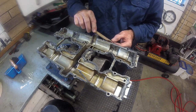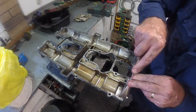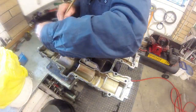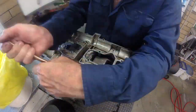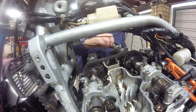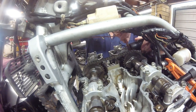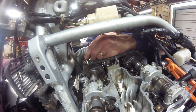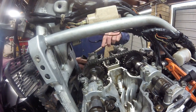The copper won't mark or gouge the aluminium alloy like steel would, so it is well suited to the task. Here I'm cleaning the silicone off the valve cover, and also off the cylinder head's mating surface using the same tool. This time I have the shop vac going to suck up any loose fragments before they can fall into the motor. I'm especially careful around the top of the cam chain tunnel, and once done I inspect the top of the head for any missed fragments and pick them out with tweezers.